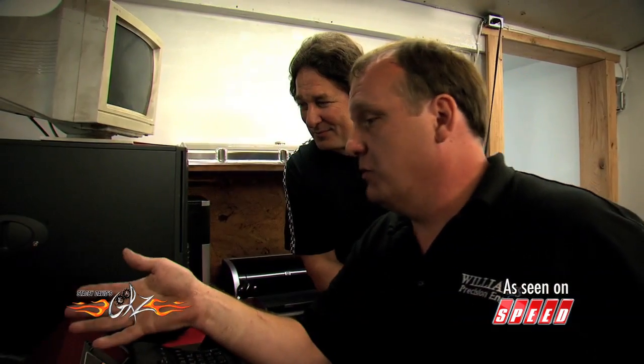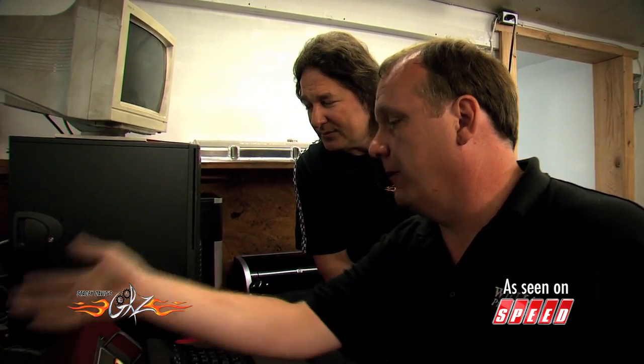The most significant thing, in my opinion, is the gain in torque at 3,700 RPM — right where the converter just takes hold and starts pulling. We jump from 428 up to 435. That's significant, that's worth it. That's awesome. Yeah, I think everyone's trying to get every bit of efficiency they can — whether it's a little better fuel efficiency or a little more horsepower. If a fresher set of plugs can give you that, why wouldn't you?